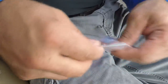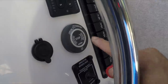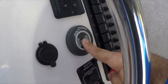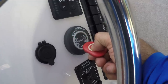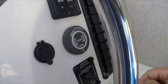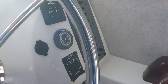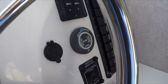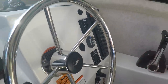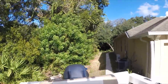I've got the wireless device and now I'm connecting the battery. It's blue now — it's searching for the Bluetooth connection. I press the MOB button and it's connected. Starting the engine and pressing the wireless device — it's now green and shows one fob is connected. The engine is on, it shows one controller. If you have several fobs, it will light up on the different sides. Now I'm going to walk around the boat with the fob to see if it shuts off.